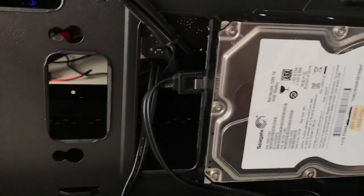Now would be a good time to install the power supply and that should be about it. The way this power supply installs is interesting — there's a bracket you screw it into that comes from the back of the case, so you slide the bracket up and screw it in from the back. Now that the PSU is screwed in I have a dilemma: I'm routing all cables through the right-side hole rather than the left, since the left would be cramped and the right side leaves room for the Pop Vinyl on top of the power supply.